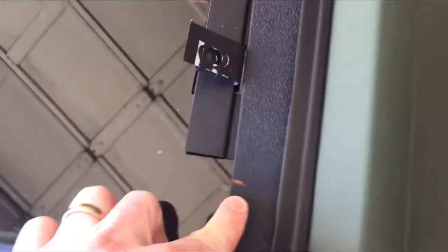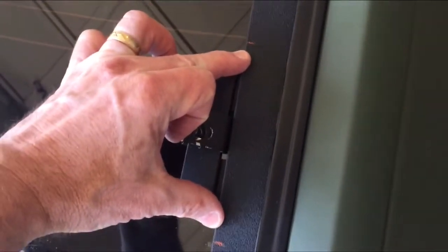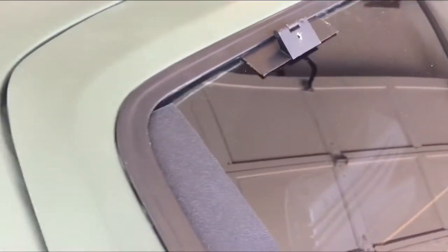So while I'm giving a day for these hinges to firmly adhere to the window, I'm going to put the filler strips in, and you can see how that's going to fit in there like that. And by the way, the notch goes to the top, and what I've done here now is I just marked with my orange grease pencil on the filler strip between those 2 spots. I'm going to actually remove the tape just so it sits a little more flush on the brackets. And you can see, essentially brackets there, the filler plate, you can see the little notch in there, that's going to go in towards the bracket on the window.